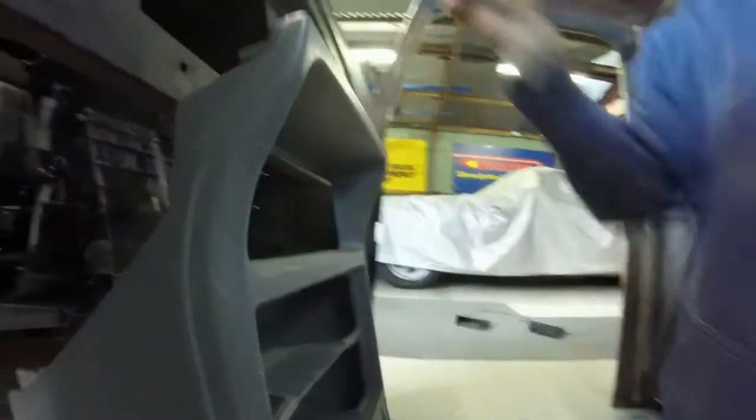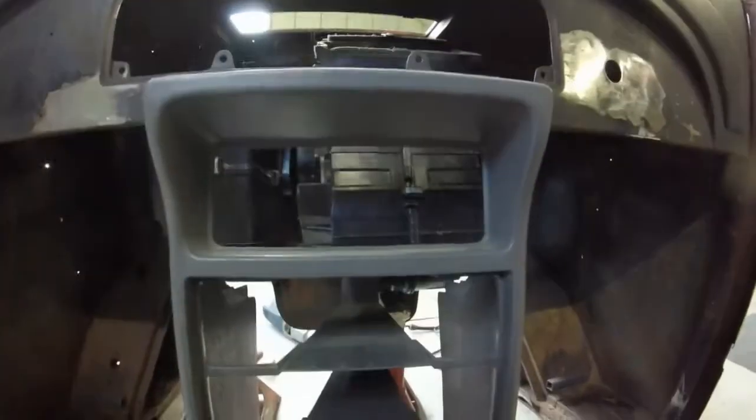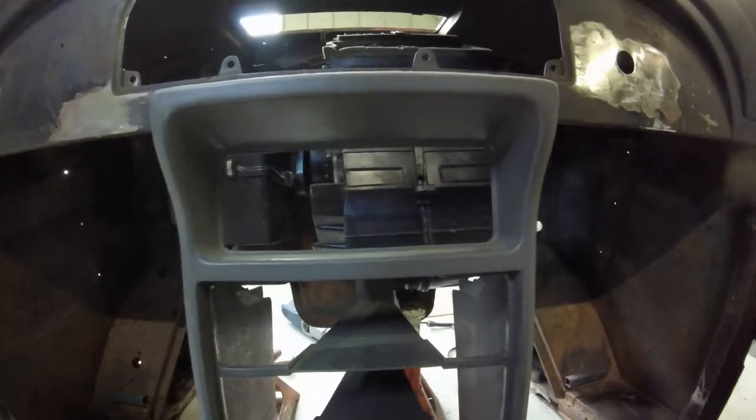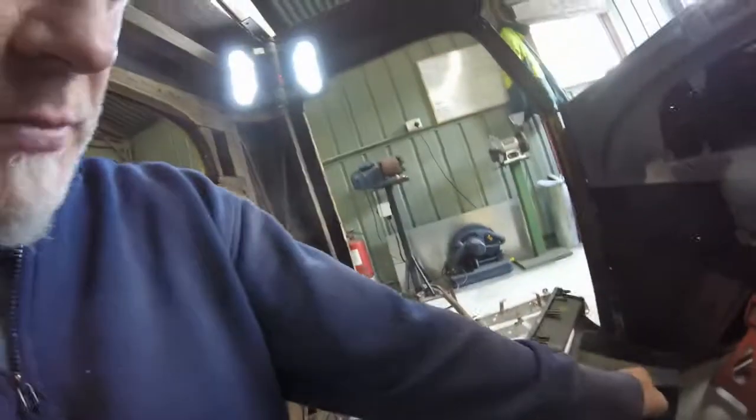It turns out that the second and third slots are identical, so I can always move the CD player down to gain more clearance and put the bucket in there — which is a lot shallower than a CD player. I can also chop off this top support piece here if anything gets in the way. As it sits at the moment, I'm going to try and line up the center of my dash — roughly between these two holes — and that's the center of the console.